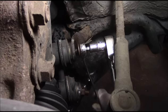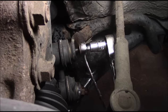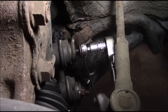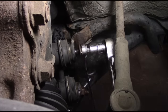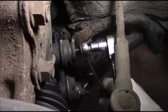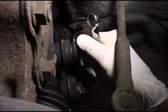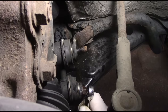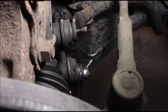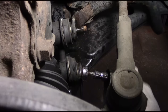Basically you're just holding the center shaft with that 5 millimeter torx and you're rotating the nut. Make sure that the 5 millimeter is perfectly straight - if it twists a little bit sideways you're going to wind up having to cut the end off. All right, this one is off and we're going to do the exact same thing on this bottom one over here - just hold it in place and rotate the wrench. Make sure your torx goes in all the way.